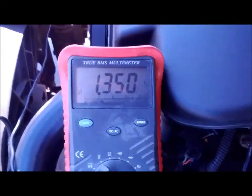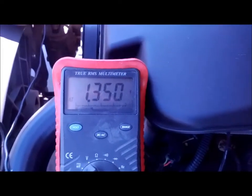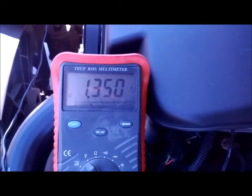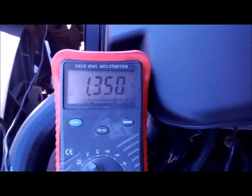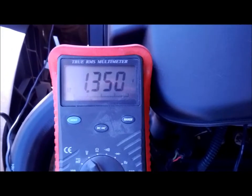So that's leading me to believe that this throttle position sensor is bad, which very well could be a problem with shifting at about 25 miles an hour — my transmission hunts for the gear if I'm coasting. So I think I might replace this.